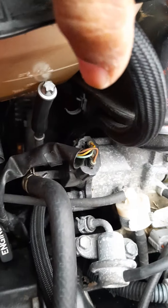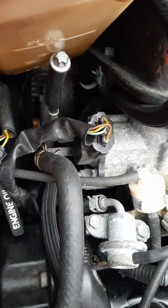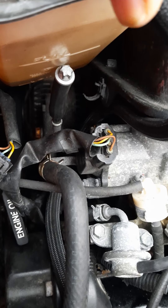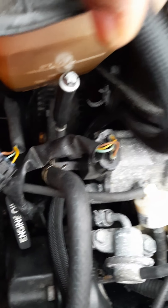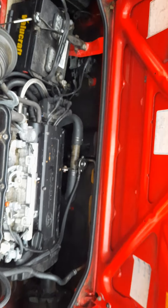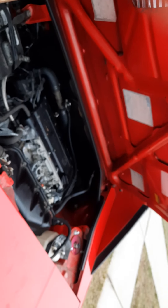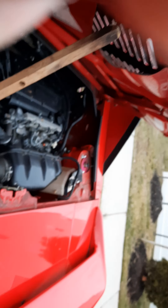The system was completely flushed and cleaned out, and the idle was actually set. The vehicle ended up having a vacuum leak. The vacuum leak was attributed to this little metal bolt here — the little six-point head that's kind of pressed down into this rubber hose. That little nipple where the rubber hose was sitting was actually open, taking on too much air, causing the vehicle to rev at about 2500 RPM during a cold start. That's been replaced, so now we're going to go ahead and get started with the actual engine start.